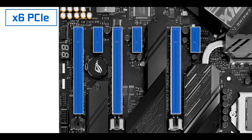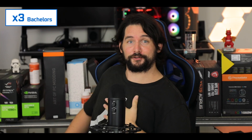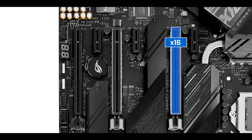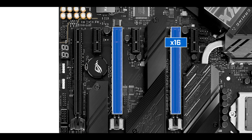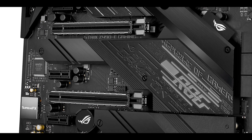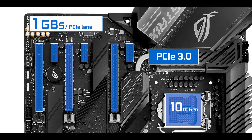Expansion-wise, we have six PCIe slots: three x1 single-speed slots, and three x16 slots with different speeds. Only the closest one to the CPU delivers full x16 bus speed — that's where your video card should go for optimal performance. In a dual GPU configuration, slots share bandwidth in an 8x8 configuration, and with a third card, we get an 8x8x4 configuration. A great board for single or dual GPU setups, hence the metallic reinforcements on those two x16 slots. With 11th generation Intel and PCIe 4.0 enabled, this bandwidth will double, giving this board a certain level of future-proofing.